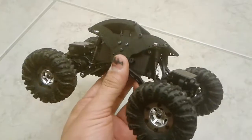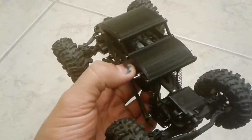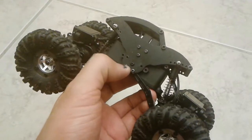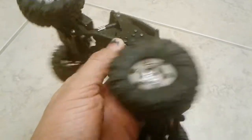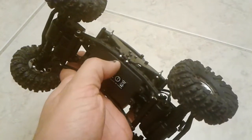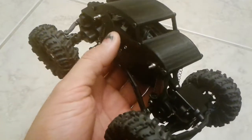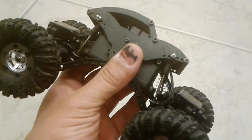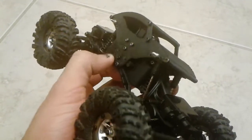I made it two different thicknesses. This is the 1mm thickness. The problem with the 1mm thickness is that you're going to have to find shorter bolts, because the original ones are designed for the chassis and the original one, and they go through too far if you use the 1mm chassis. So I made a 4mm chassis side plate so that you guys can use the same bolts. If you have the short ones, just go ahead and use the short ones for these areas here.